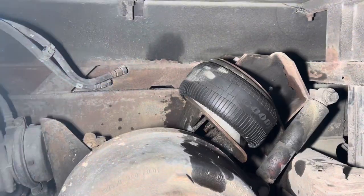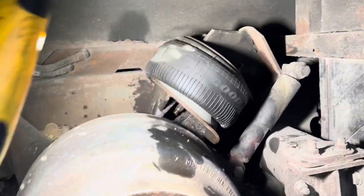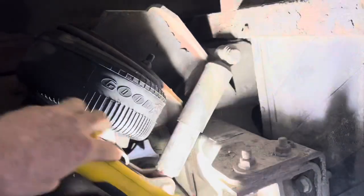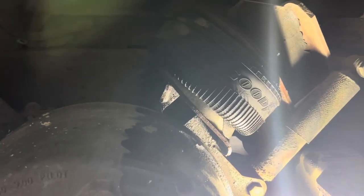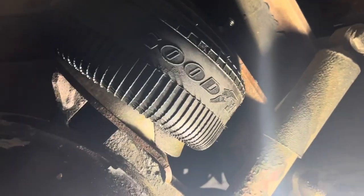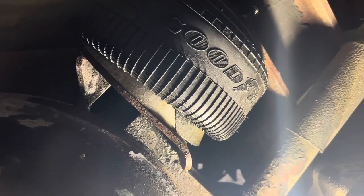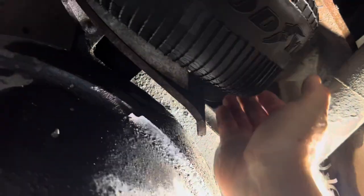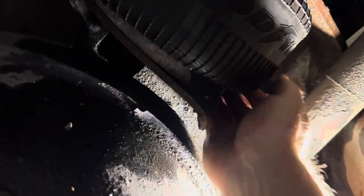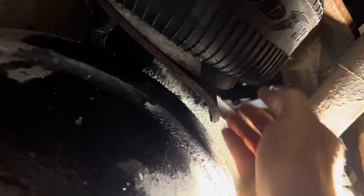I have racked my brain crawling around on this thing trying to find where the leak was coming from, and I finally found that it really was the tag axle. I have sprayed soap and water all over this thing and cannot find it bubbling. However, I can actually hear and feel the air blowing out from around the metal plate where it bonds into the bag.